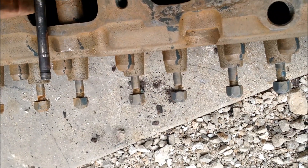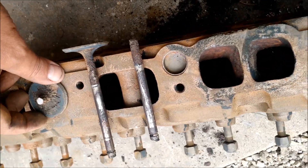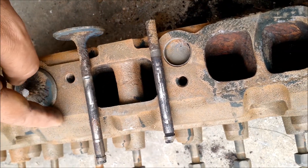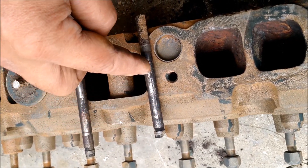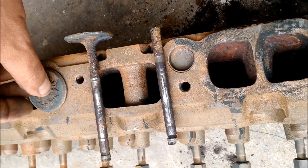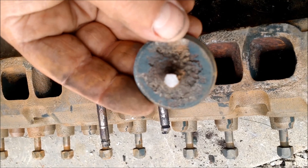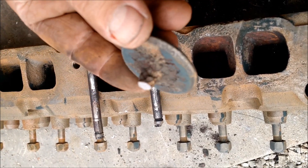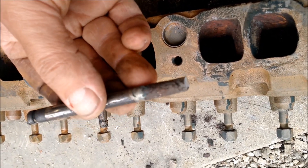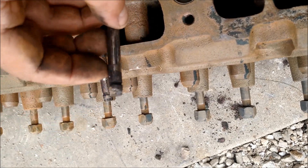This valve was stuck, this valve was stuck, and this valve was stuck — they were so stuck you couldn't move them. But after soaking in the molasses, it works up the valve guide. I'd baked this head so there was no oil left in it, and all that rust was dissolved along the valve stems. They didn't slide out real easy — you can see the head broke off this one because I had hit it prior with a hammer and it fatigued it. But working it harder, it came out. You can see how rusty that valve is, and the rust along the valve stem surface. The tip did break as I was pounding it out.